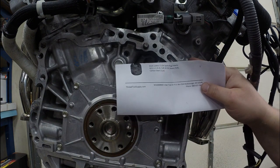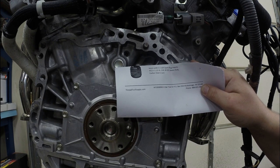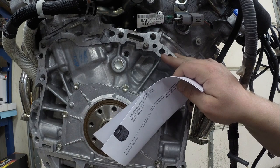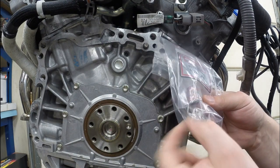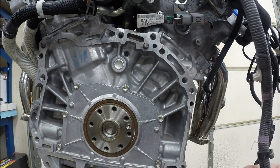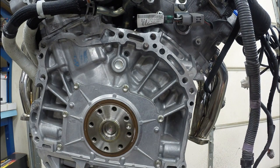The company I used is threadtoolsupply.com, and the part number you want is 9329-1208 — it's an EasyLock spark plug insert, M12 x 1.25 ID with a 5/8-18 OD. That lets you use a standard 5/8-18 tap in that hole. Drill it out slightly, run the tap in, then take your bolt, run a lock nut down to the depth you want, and simply screw that insert into the hole. It saves money over the actual kits and should work just as well.